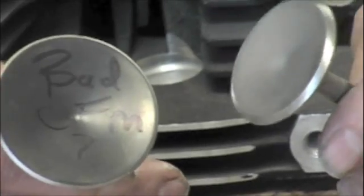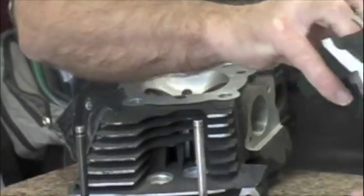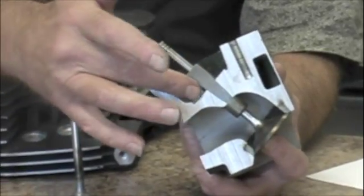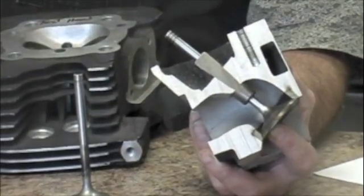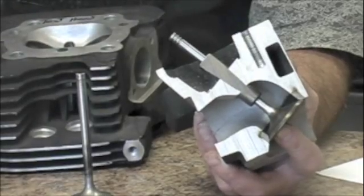The one thing I want to make sure that you understand is that when we do sink the valves, you do lose compression. The other thing is bringing the valve up farther changes the valve protrusion — that's the distance from here to here — and also it'll change the spring pack pressure so that you'll have to shim the valves and adjust accordingly.